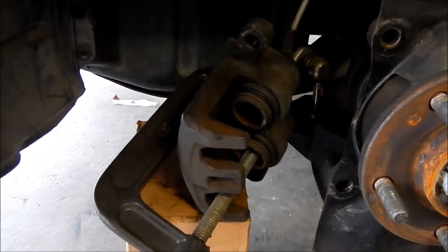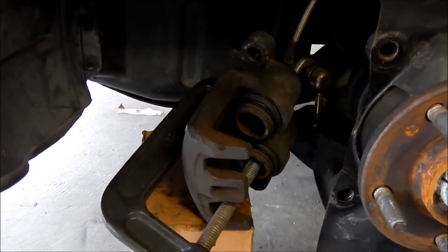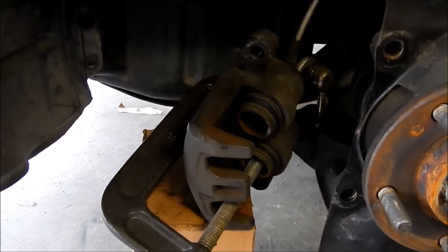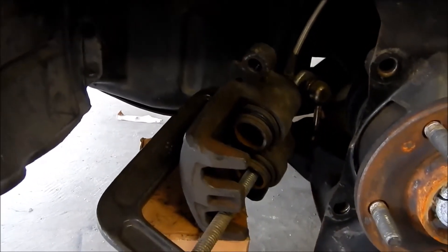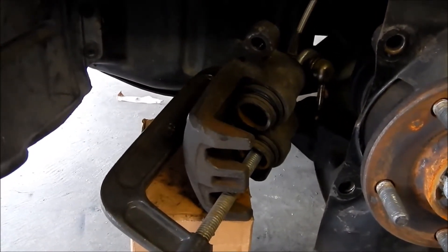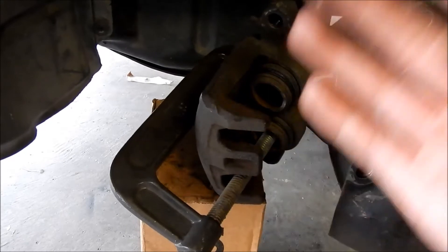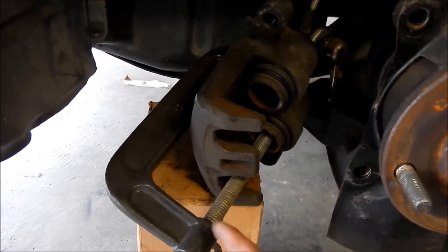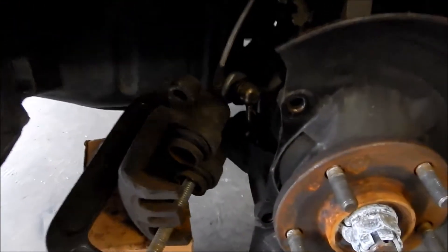I kind of want to just get a new caliper so I don't have to worry about it anymore, but that would be more work, I guess. Plus I don't see anything wrong with it — other than it looks like this one comes out a little more easily than that one, and that's why I'm thinking it's pressing out cockeyed. So I'm going to work it in one more time and then push it out. I'm going to pump the brake and have this come out again — see which one comes out first, then stick the clamp on it and push the other one out. It's kind of a pain in the ass having a dual piston caliper. Just imagine if you had four piston calipers — it would be even more of a pain in the ass to work on.